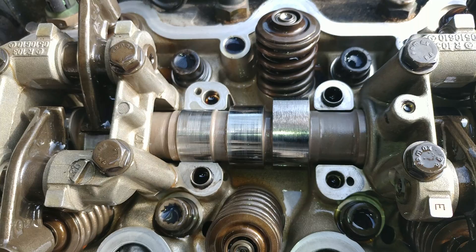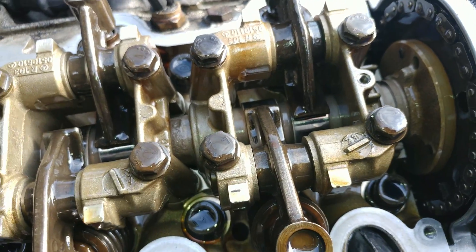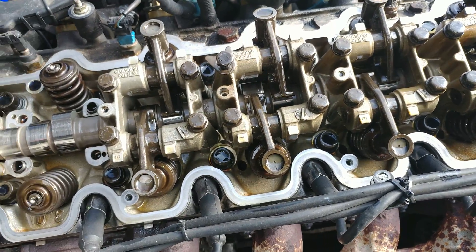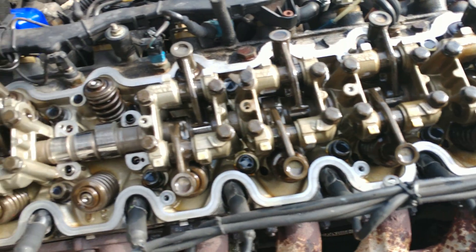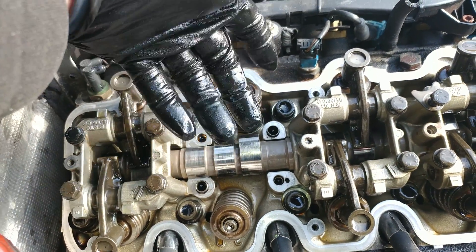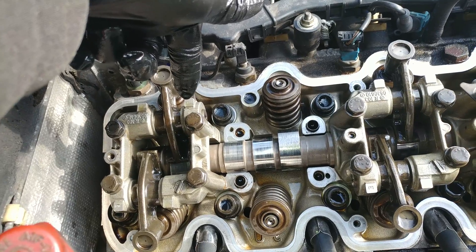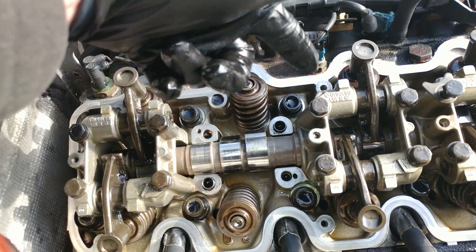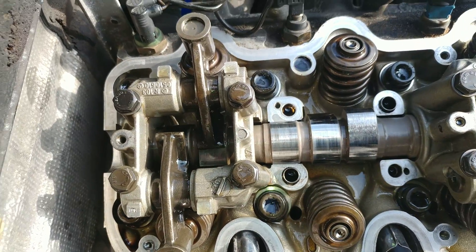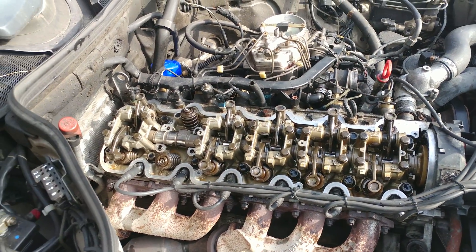At this point the rockers and the camshaft need to be replaced. The bearing caps — I'm not sure, I'm not a motor builder, it doesn't seem super difficult but I'm not the engine guy. I ran the car with the cover off just to listen for where the noise was coming from exactly. It turned out this one was coming loud, and this one just a little bit — this area was the loudest. I figured it was this lifter, but usually lifters go on the exhaust side and here we've got the intake side. I just wanted to document this, show you the video, and then we decide what to do further.